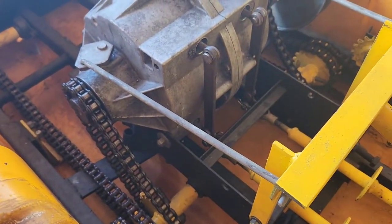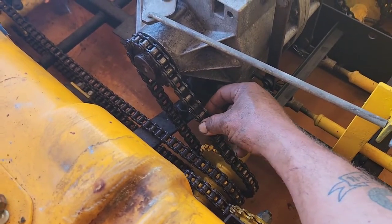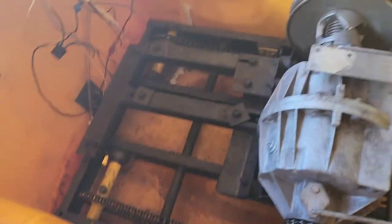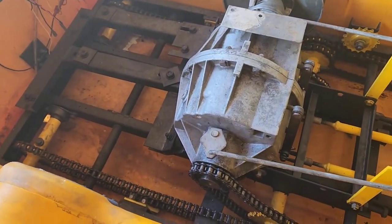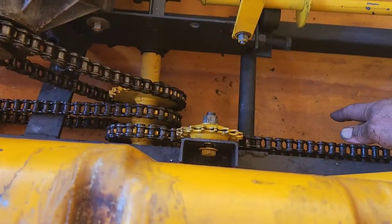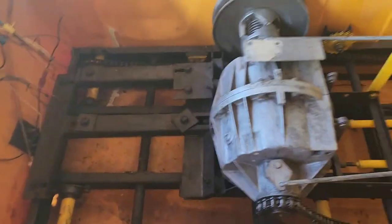You can get good tension on those. They don't have to be crazy tight — you'll want about one-fourth of an inch deflection, or looseness. One-fourth of an inch to go back and forth, and that's how you know the chains are nice and tight. So right now I'm going to leave them loose until I can make some other adjustments and get the transmission and engine pedestal loosened up to at least tighten these up before I tighten the drive chains up. That's how you work the chains.